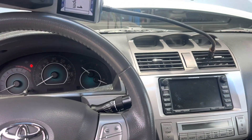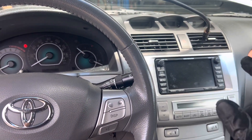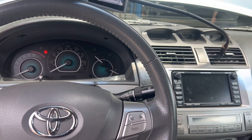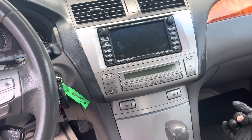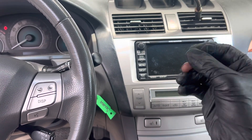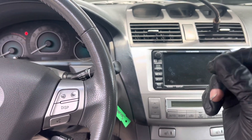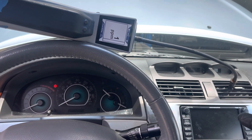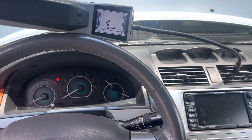We live in a state, in a city with an extremely high labor rate. And it's almost better to prove this one — run it with refrigerant with UV dye — telling them it's a possible evaporator leak, trying to go up underneath and see if there's easy access to any kind of device that could be pulled out, a sensor or anything out of the case that we can easily get to, and try to get a little bit closer and use the UV dye as evidence for diagnosis later on when it runs low on refrigerant.